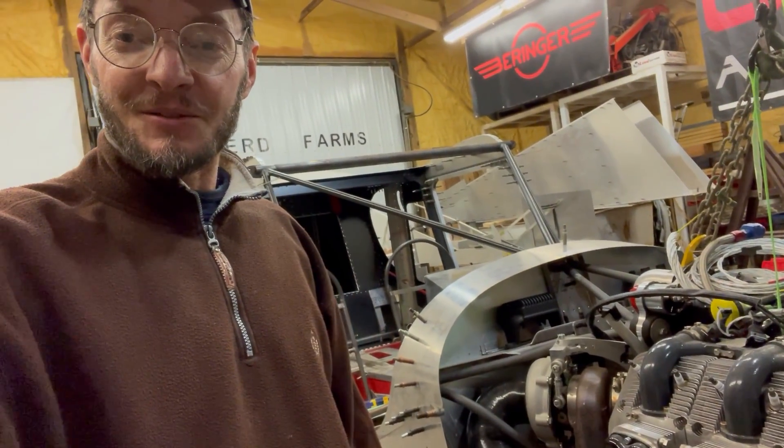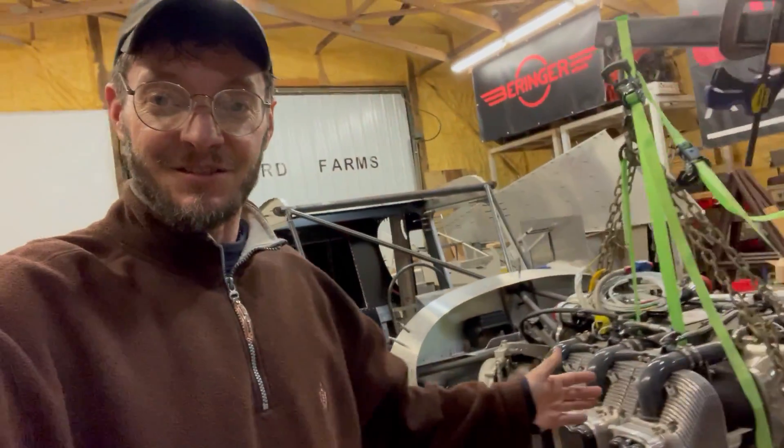I'm not sure I would recommend building one, because it's turned into a major hassle — a pretty good headache to build the actual engine mount, and a big time headache trying to make everything fit. So that was number one: it just wasn't available and I knew I was going to have to do something. And if I might have to do something anyway, I wanted to be able to shift the center of gravity on this airplane back just a little bit while I'm building. The only good way to do that is to shift the engine weight back. I've made this engine mount six inches shorter than what's commercially available, which shifts the entire engine assembly back six inches. That moves the center of gravity back a considerable amount, since that's a pretty good amount of weight on the airplane that you're shifting back.